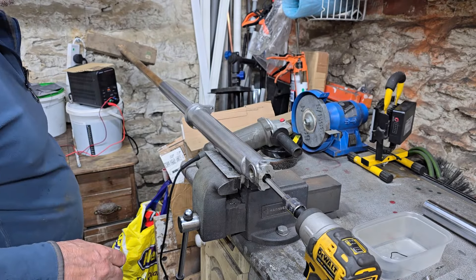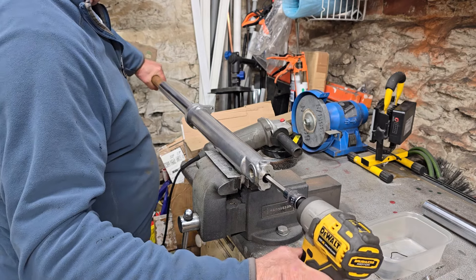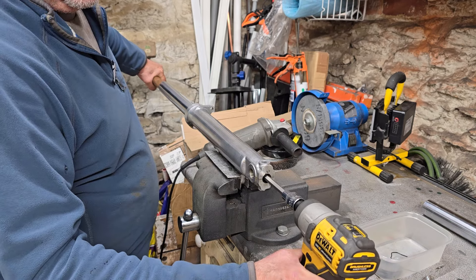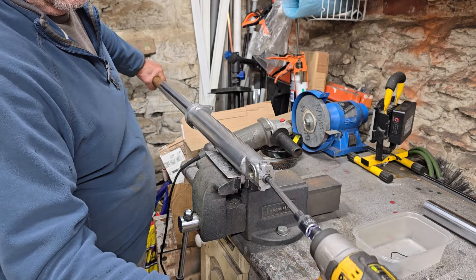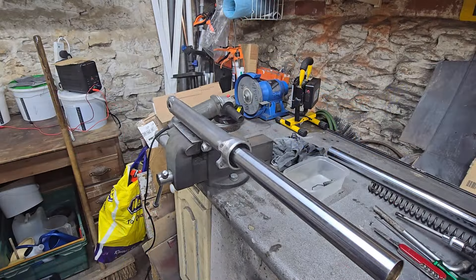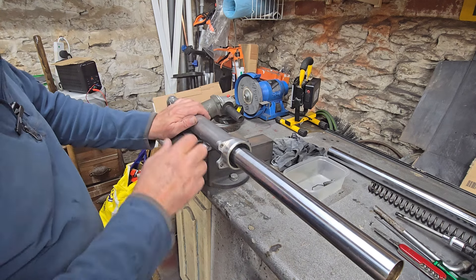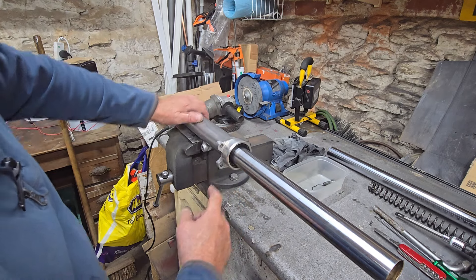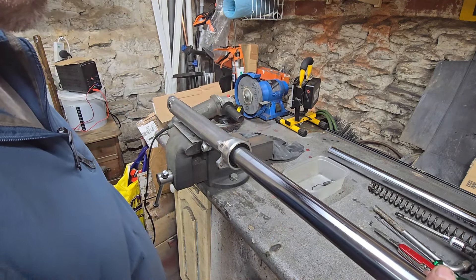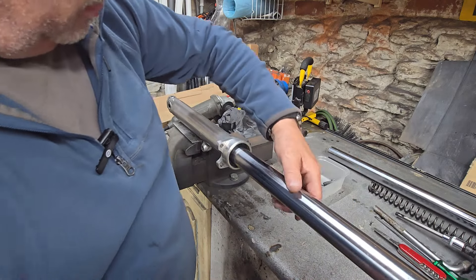Who needs a special tool? A yard broom as it might be called in America, or a brush as we'd call it in the UK - I'm holding the brush against the damper rod. Aha, as if by magic - we're out! There's now nothing holding the damper rod assembly into the outer fork leg apart from the friction pressure of the seal, so it's just a question of gently using the inner leg as a slide hammer to knock this seal out of place.